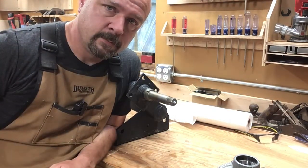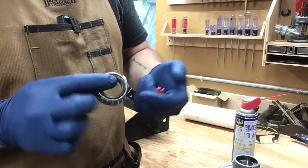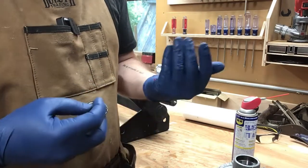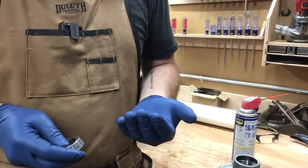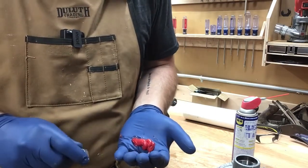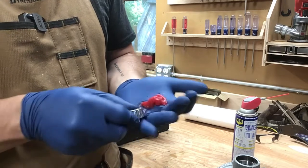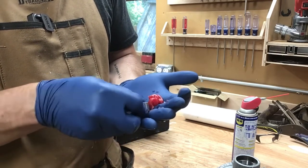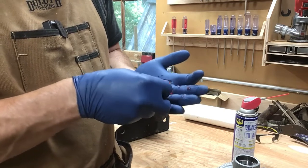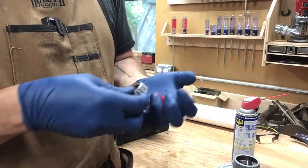So we'll start by packing the bearings. There are a few different ways to pack bearings. You can buy a machine where you clamp this bearing in and force grease in and it gets all the grease in amongst these roller bearings and out both sides. I hand pack. I learned this from a guy that was a Marine Corps CH-47 helicopter mechanic — they had to hand pack all the bearings. So I'll show you the method he taught me. Les, if you're watching, thank you for that. So a little bit of grease in the palm of your hand. You take the bearing with the wide edge down and you just take little bites and work it in until it starts coming out the top. You can see right here it started coming out the top between those two roller bearings. Then you just pull that extra grease out of the middle because there's always extra grease in the middle.